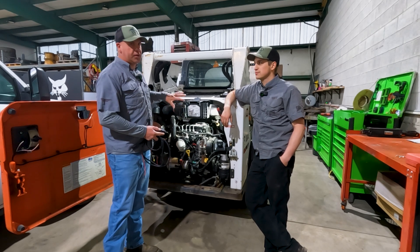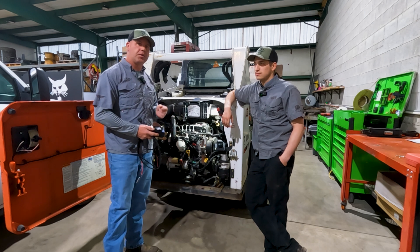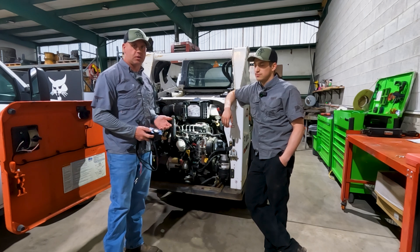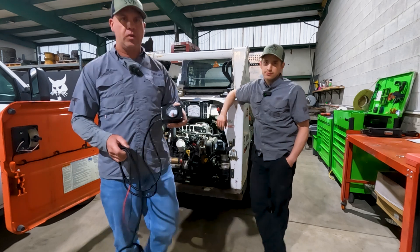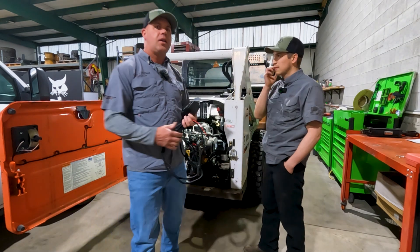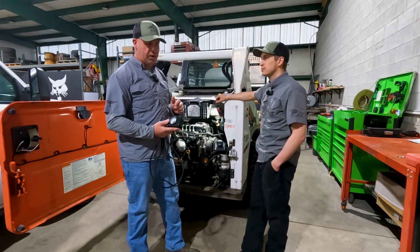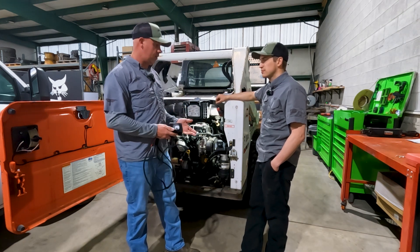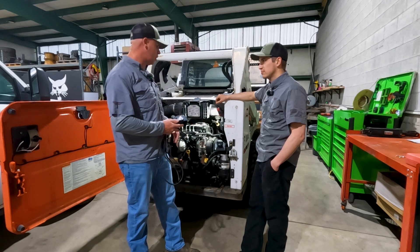This one is a perfect example of a rail pressure issue, but without software it's hard to know what your rail pressure is. That's why we built a gauge that we can tee into the rail and it'll tell us what our rail pressure is. Without software, this is a very important tool to help us see what's going on with the fuel system.